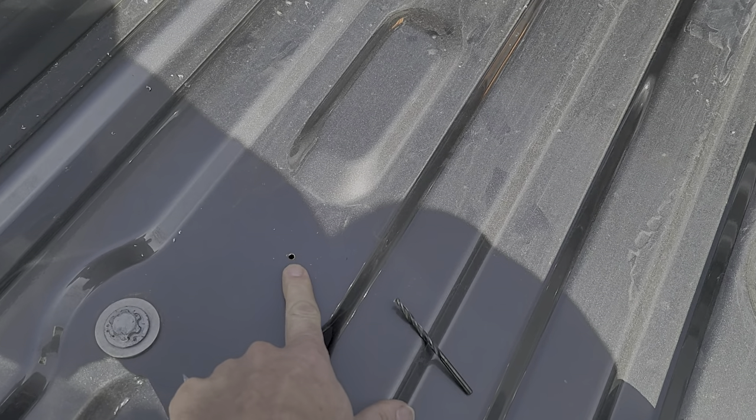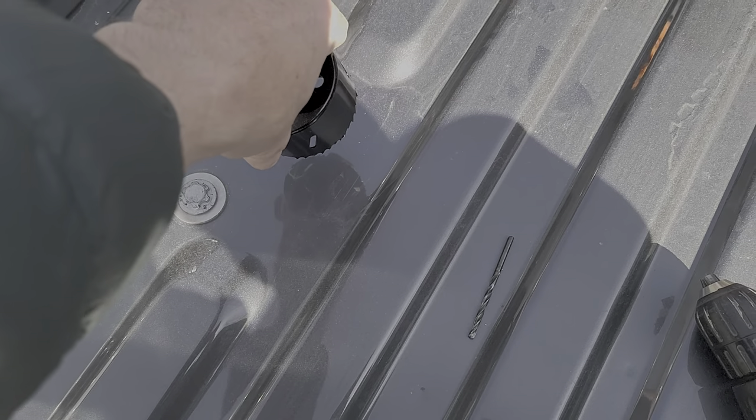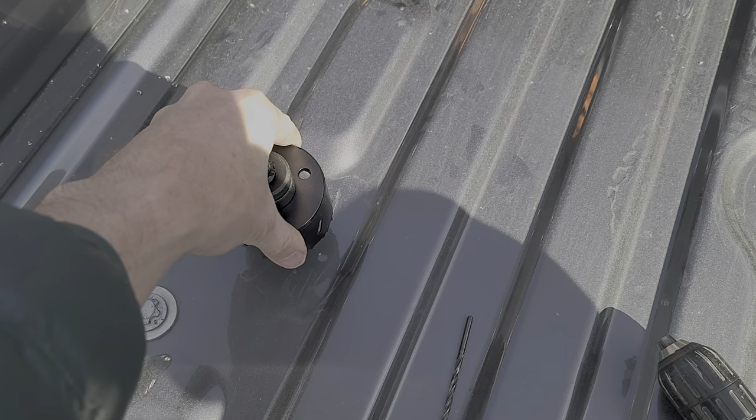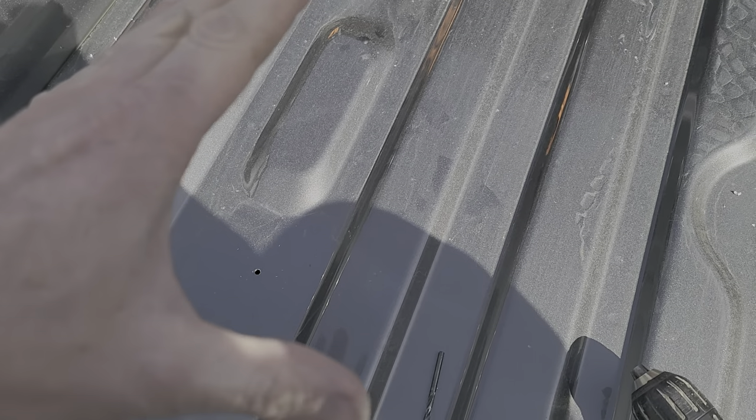In the bed there are little dimple holes where we're going to take a smaller drill bit initially and drill those dimples out. The reason is once you put the hole saw in here it's hard to see that hole and line it up right. But by drilling the dimples first, the holes are lined up and it's going to cut right through to the meat and potatoes. I've already gone and drilled out the little dimples — I like how Ford basically preps that for you. There's nothing underneath the bed on mine that's going to interfere. I'm going to bring you back once I cut one hole and show you what it looks like, because the sound of a drill cutting through metal is like nails on a chalkboard.